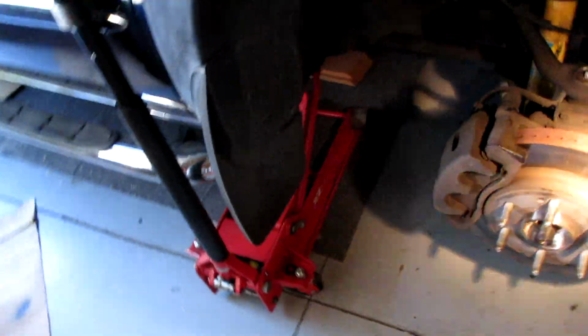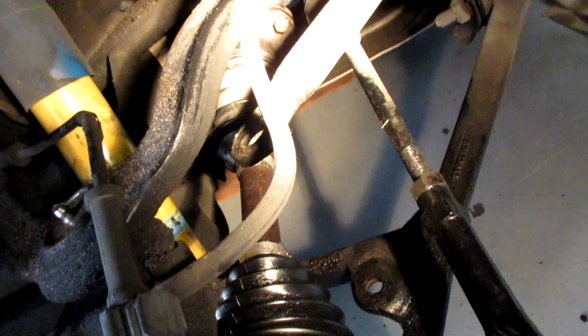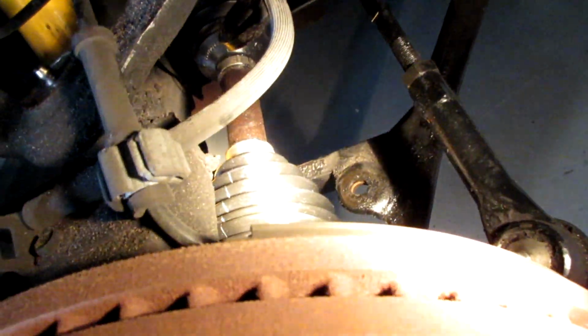But here's what we're going to talk about. Look at that grease. Six months it was leaking. That's called a companion flange. In a lot of cars they just have a circlip on the end of that, and you gotta whack it out. It's more of a pain in the ass. I just put a little blue Loctite on those. I forget the torque spec on those. I think they're like 40 foot-pounds or something, maybe more. Probably gonna do like 45, and then we'll come back later.